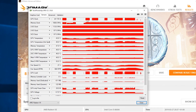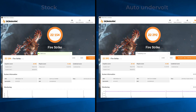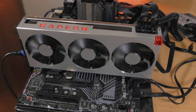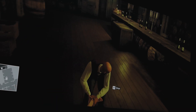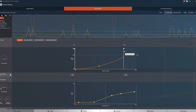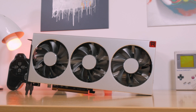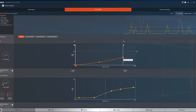What was also interesting to see is that the performance and clock figures went up a bit, so when you draw the line, using the auto-undervolt option you'll get a quieter and slightly better performing Radeon 7. But I wasn't here just for that — I wanted to go a step further by incorporating some overclocking into the mix. Here I first tried to find the right sweet spot between getting that extra performance and not getting too noisy. Although I could ramp up the GPU clock speed to around 1950 MHz, it just wasn't worth it for the extra noise, higher temperature, and power consumption required to reach that point of stability. So, as you can see here, I settled down with these settings.